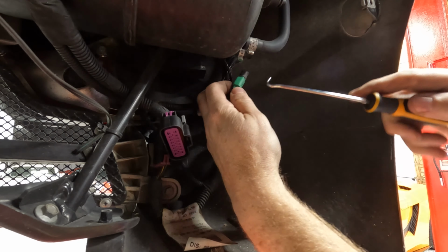Okay, so you use these rubber muffler mounts. You have to rip them off the old mufflers, so don't forget to do that if you're throwing those away. Make sure to keep those. Spray a little bit of WD-40 or something on them to let them come loose. But yeah, they're a pain to get off. Don't forget to slip the clamp on first, otherwise you're gonna be cursing later.